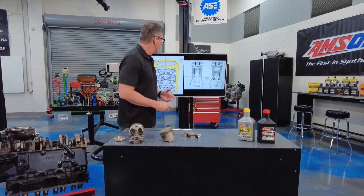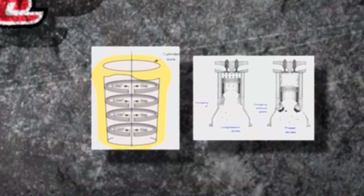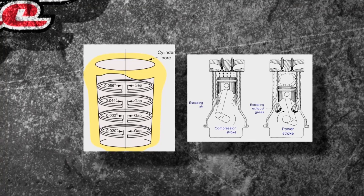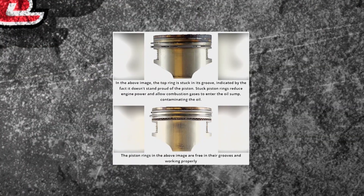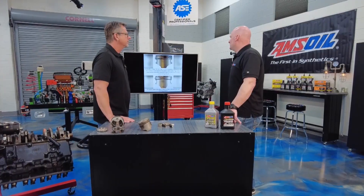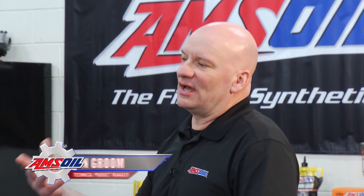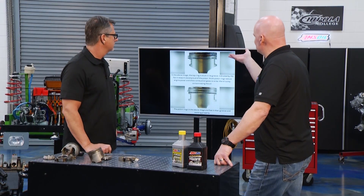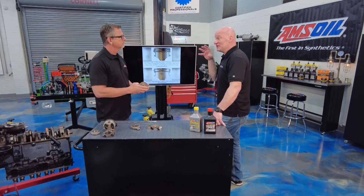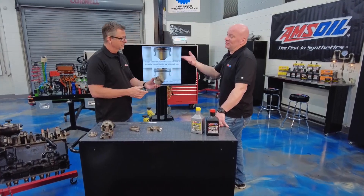You can actually take one of these bearings and scratch it with your finger and do damage to it. When we talk about pistons, you've got rings that have to go down to the bottom, and that's got to seal this blow-by. That stuff's getting down into the oil — that's a problem. You can see it right here with the graphic. What's going on is the rings are sticking. What causes ring stick is the oil actually oxidizing and breaking down from the heat of combustion. That piston is seeing combustion heat — it's seeing flame. And if the oil is not robust enough, it'll deposit, the ring starts to stick, and then it's like a snowball effect where it just keeps getting worse and worse until you're losing compression and losing performance.